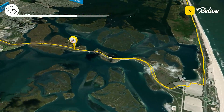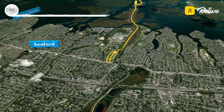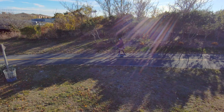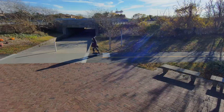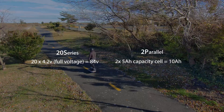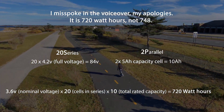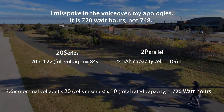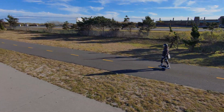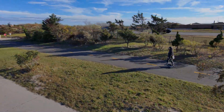On this ride I was able to ride 26.5 miles or 42.6 kilometers before the board went into low voltage tiltback and made me stop — at that point I consider the range test complete. The battery in this build is a 20s2p configuration, rated at 740 watt hours. For context, rider weight, ambient temperature, and ride style will all affect energy consumption and therefore range. This wraps up the series of range tests, and there are reviews and build highlights to follow, so make sure to subscribe. Thank you for watching.